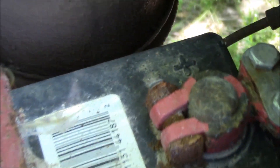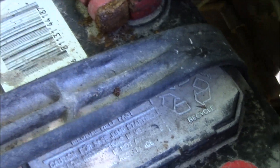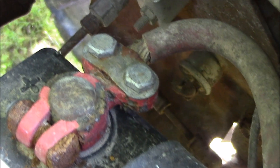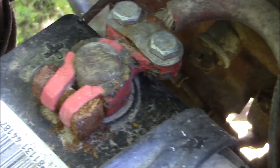Here in the battery compartment you see the positive wire comes around and is grounded to the frame, so today the system as it sits is a positive ground. The negative wire comes down and runs to the starter. One of the things we're going to be changing during this conversion is going from a positive ground to a negative ground, as well as from generator to alternator.